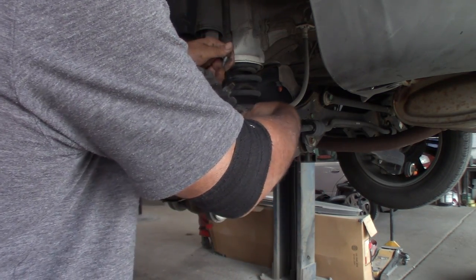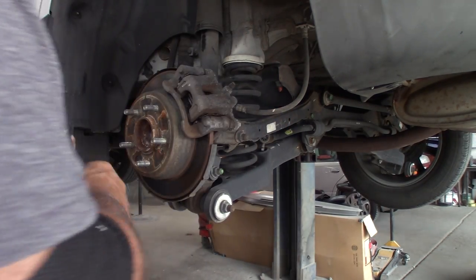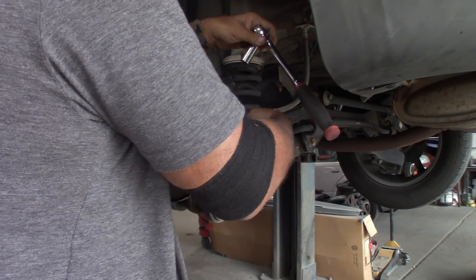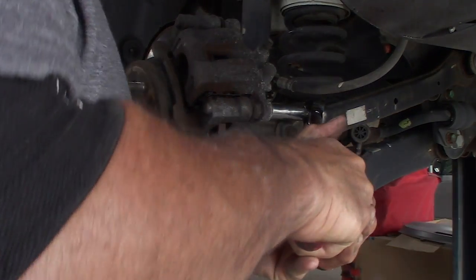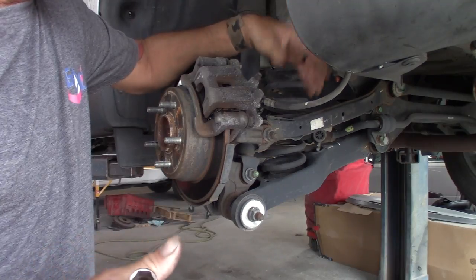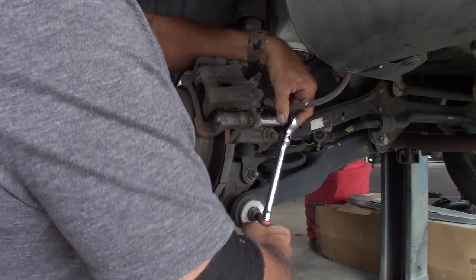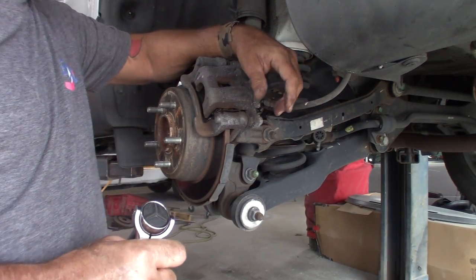Go back with your caliper bolts — they are German specs, good and tight. There are torque specs on these; 80% of mechanics don't use it. Sometimes I do depending on the car, but on a car like this I know that if I go hand tight without over-killing it, that's going to be within specs. I've done so many of them that I can probably get it within 10 inch-pounds.